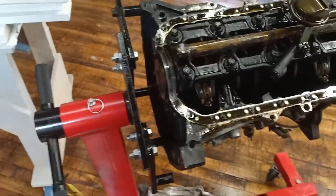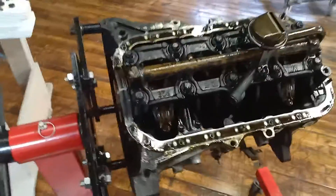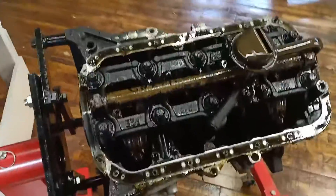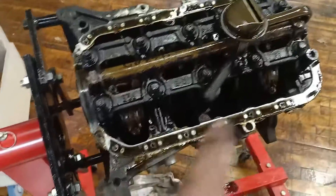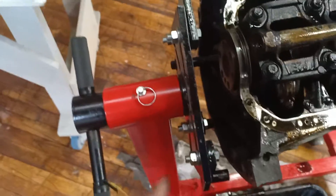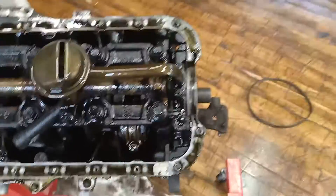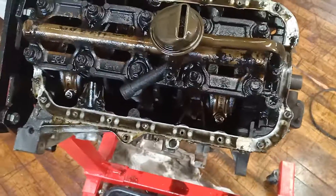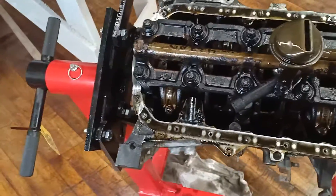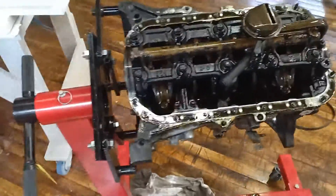What's going on YouTube? Right now we are taking off the girdle, pistons, rods, and crank. What I did was take the oil pan off with a bunch of 10 millimeter bolts all the way around. Then I took the flywheel off to get to the rear main seal. We'll also have to take the oil pump off, and then we should be able to take the whole girdle off and start pulling pistons to get it down to as bare a block as we can.